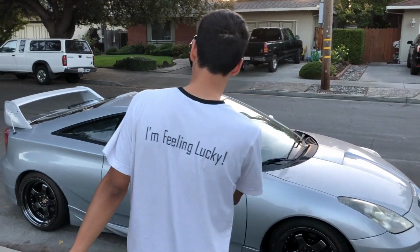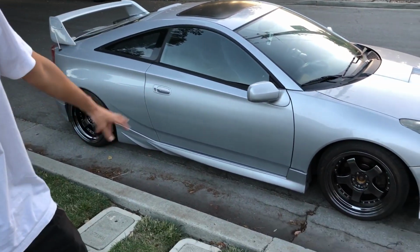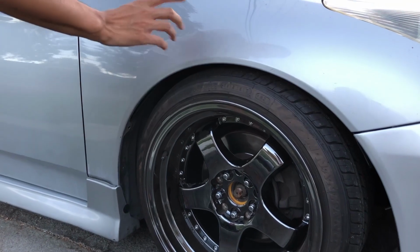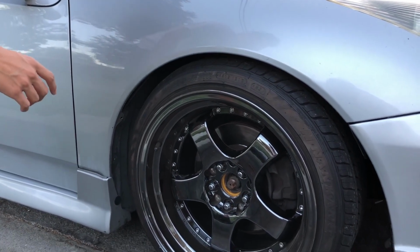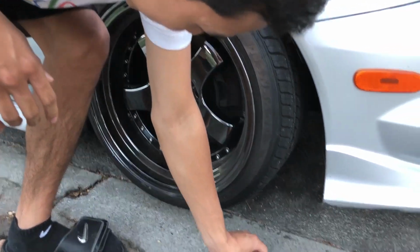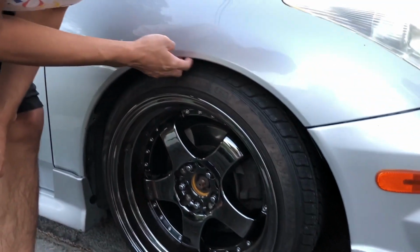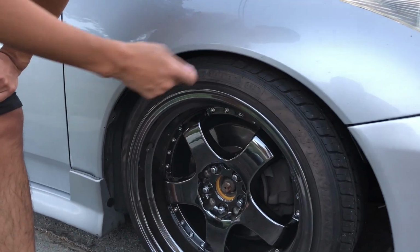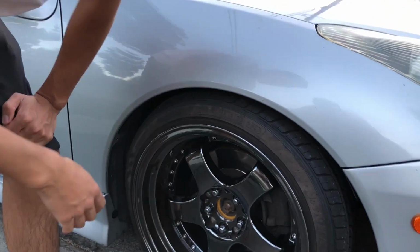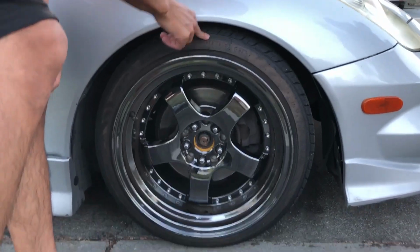The next day. As you can see, I got the front wheels on, and I got everything settled in. Yeah, it took a lot of effort, to be honest, because even though both coilovers on the front were pretty even, the right side kept rubbing. You can see some rubber kept rubbing on the inner fender lip, so I had to raise this side only, and it took me like 3 tries to finally get it right. It's not rubbing anymore, at least I hope it's not.